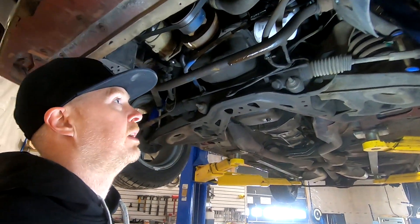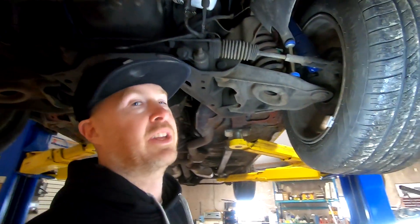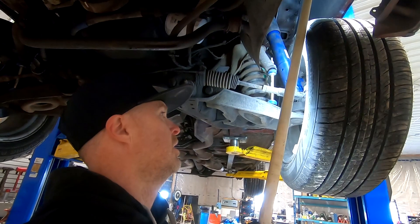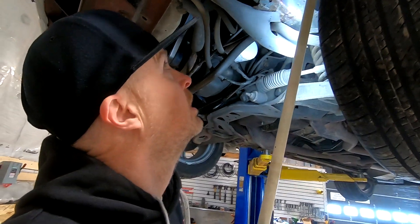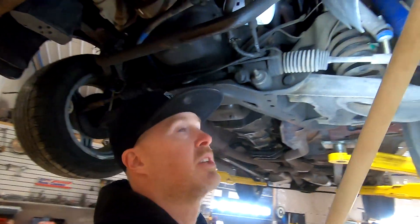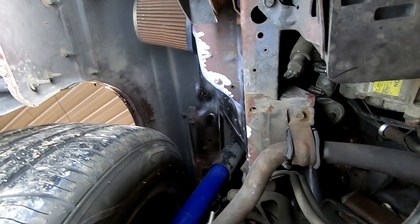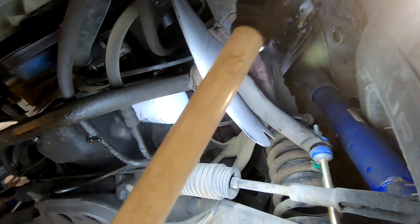So you can see our power steering fluid leak on the sway bar. I got myself another sway bar, so I'm excited about that — I can never have enough of those. It looks like you have some really nice new end links and new struts. I'm not sure what kind of struts those are. All I know is that he said he got the struts and was replacing them, and when he replaced them he noticed that there was some rot in the frame rails. I'm not sure exactly where because they don't actually look horrible — it actually looks pretty good in there, to be completely honest. That's actually pretty clean looking. Same thing up here in this inner fender area — there's a little bit of surface rust in the bottom of the mount where the sway bar goes, but otherwise that looks okay.